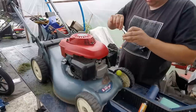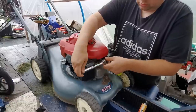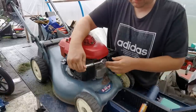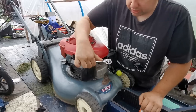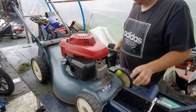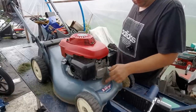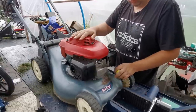It's really, really simple doing these mowers. If it wasn't running correctly or anything like that, we would have took the carburetor off, but I don't do that just in a basic service. So we're just on the biting point of that — trying to give that a little nip just to crush that crush washer — and that's that fully done. So what we've got left to do is change the oil out still. We're going to take a look underneath, sharpen that blade up, and we're going to whip this top off and get this pull cord changed as well.